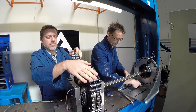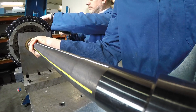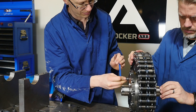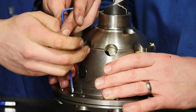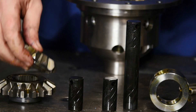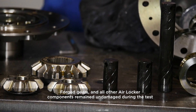Most people familiar with our product would know the older style diff — the three-piece differentials — which was a very good product at the time. Development of this test rig allowed us to further that design, and that's when we introduced the two-piece version of the differential. Over those 15 years of development, the design has not stayed still for a second. The materials have changed; we've gone to forged net gearing, which has given us amazing advantages. We've also come a long way with seals technology, cross shafts, and heat treatments.